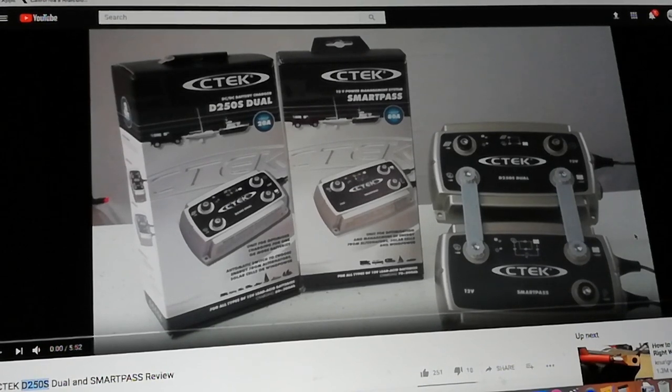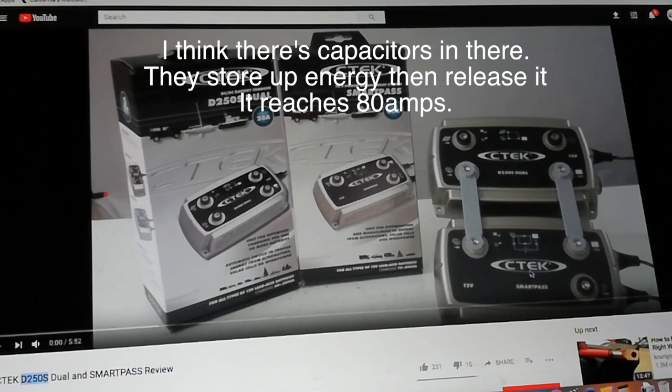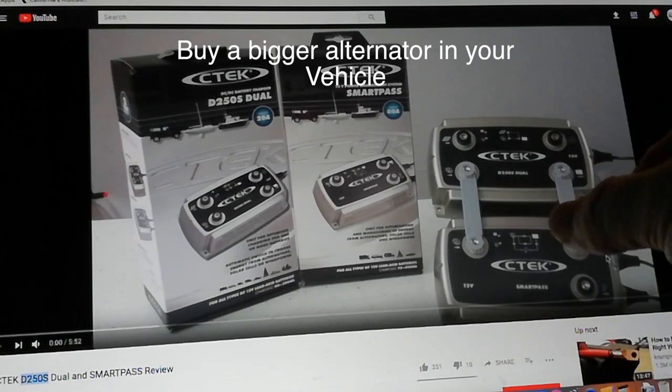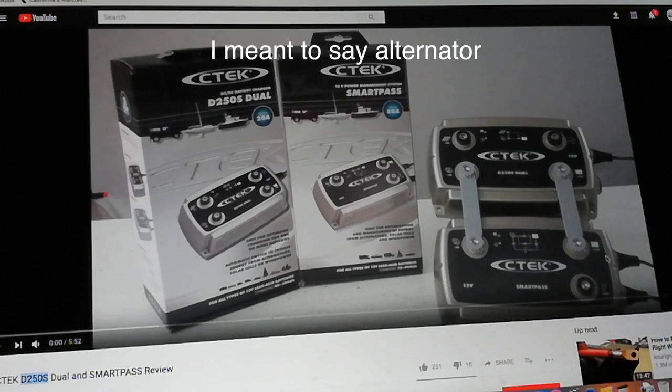So it's not so bad on price at this point, but then what is the SmartPass? This is what I was struggling with for a long time. All it is, is an upstep converter — it ups the amperage up to 80 amps. The amperage coming from the battery isolator through that cable should have a thick gauge. Even then, alternators are not capable of supplying that many amps unless you seriously upgrade it. But I think this unit stores up energy until it reaches 80 amps and lets it flow into the battery. The reason is a battery isolator can't fully charge a battery — at most it can get up to about 85%. It needs higher amperage to get that last little bit into the battery. That's what this product is.